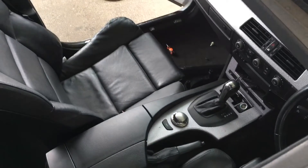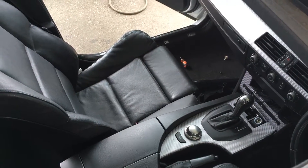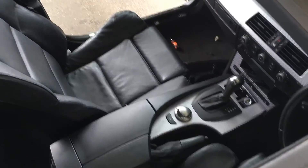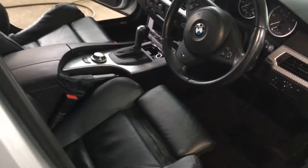Now coming across to the driver's side sunroof, we're going to do exactly the same thing — put some water in this front cassette. We can see that the water's still sitting in this bar and it's not going away, which causes it to back up. We're getting water dripping out of here — you can see just here there's a tiny run mark.